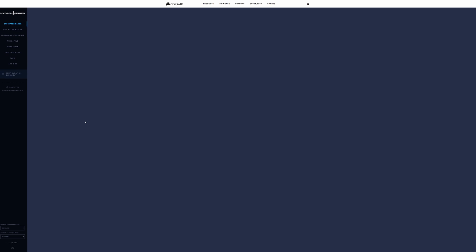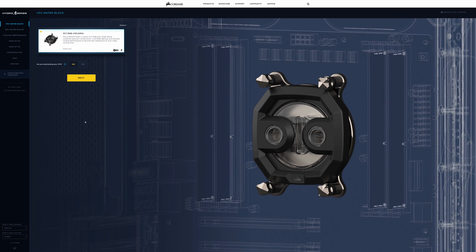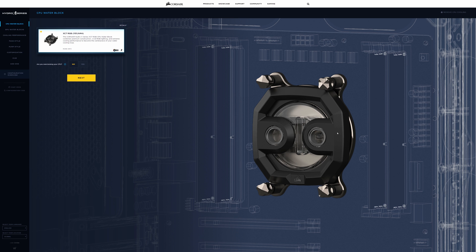We're going to click the 'see recommended setup' button. It shows us what we've chosen — the XC7 RGB — and it asks if we're overclocking our CPU. If we choose yes, it will change the radiator configuration. Without the two graphics cards, we might only need a single 360mm rad. But choosing yes would add a 240mm at the top as well as the 360mm at the front, because it knows it needs that extra surface area for the additional heat. We're going to choose no, because with two GPUs, we already have the 360 and 240mm setup. It's automatically chosen the XC7 RGB for the AM4 socket — if we'd gone with HEDT, it would have chosen the beefier XC9.